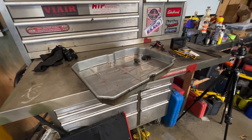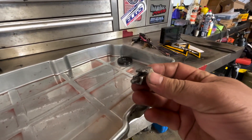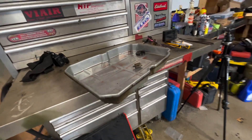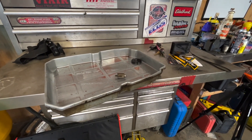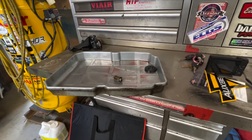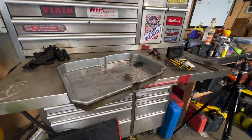So let's talk about what goes wrong with the oil pan — there are numerous factors that could have made mine leak. Like I said, I started to have seepage and I tightened it down. The problem is you can see this setup here — it's just a clip that clips on the side and bolts down. But if you over-tighten it you can actually distort the metal, which caused it to leak. Not only that, using an aftermarket gasket that may not be within tolerance — probably a little bit on the small side — could also be the reason why it leaked. It's obviously proven: the original setup did not leak. I put an aftermarket one in and probably over-torqued it, which caused it to leak. Fixed that problem with the new transmission pan that has a drain plug and actual bolts, so I don't have to worry about that.